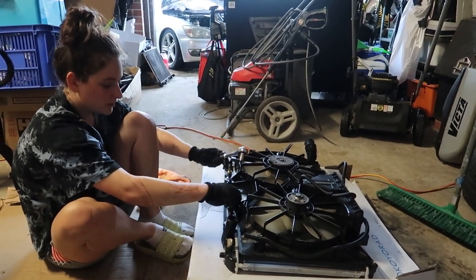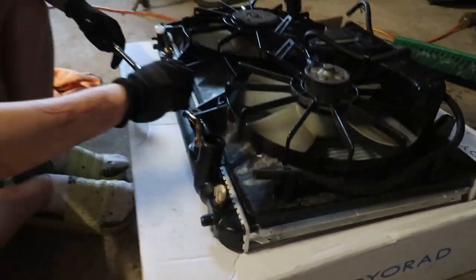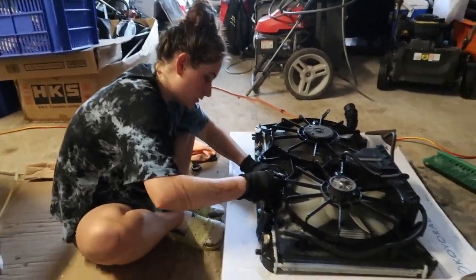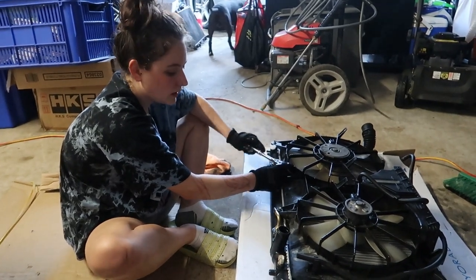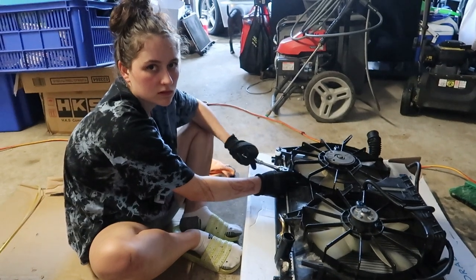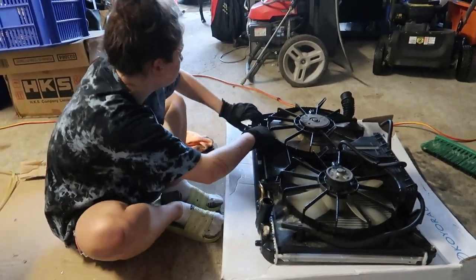We're taking the radiator out now, and we're just swapping the fan onto the new radiator. And don't forget to take your, I think it's, Daniel mentioned it could be a temp sensor. Don't forget to take that out of your old radiator. It's fairly simple. The hardest part's just going to be getting the tubes back on, but that's it. Yeah. Not too difficult, but still annoying.